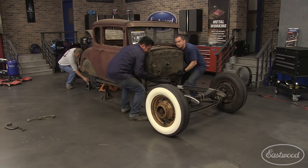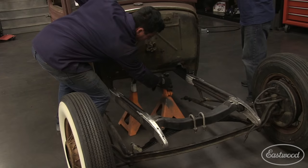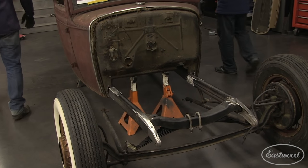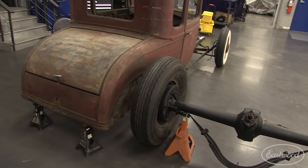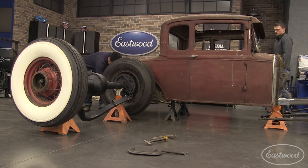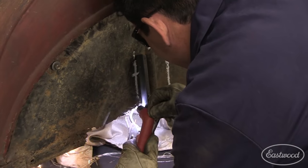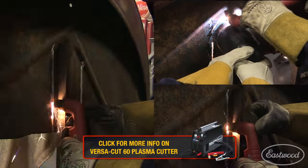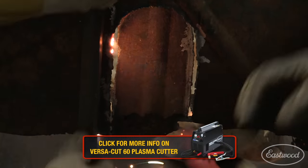Now that the floor was cut out of the bottom of the car, we were able to test fit the body on the chassis. Next, we rolled the rear axle with the wheels and tires we'd be using next to the body and transferred marks to the rear inner fenders just a little higher than the height of the axle tube. We then used scrap metal as guides to run our torch against as we made the rear axle notches in the rear inner fenders.